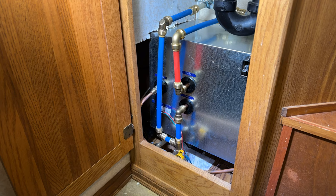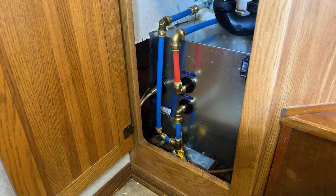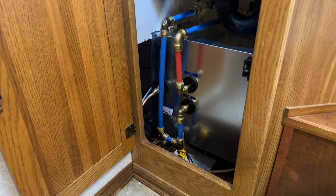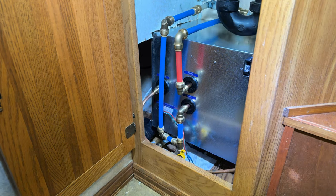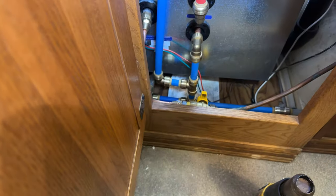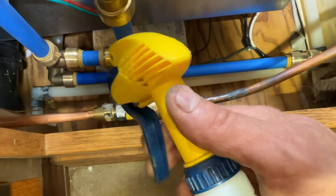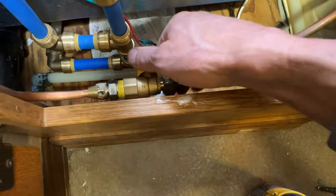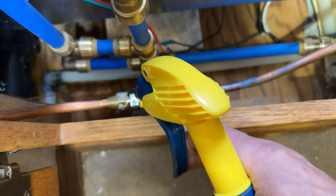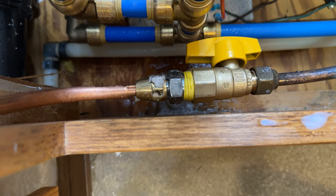I have turned the power back on to the trailer. I'm going to turn on the propane and the water. We've turned the water on and we're checking for any leaks — I do not see any. Now that we have full pressure on the water we can look again for any drips. I can spray some soapy water there, and now I can turn the gas on. No bubbles.